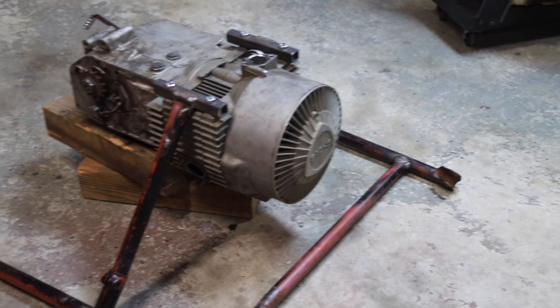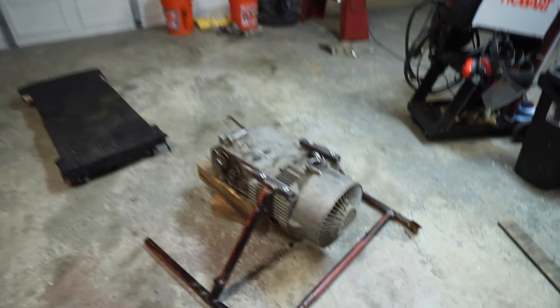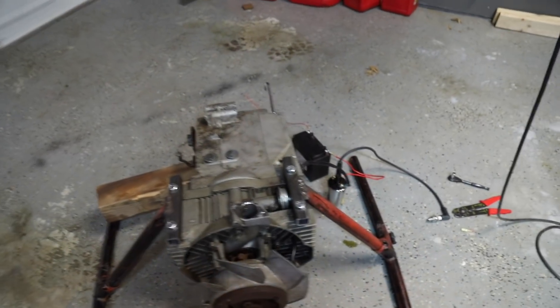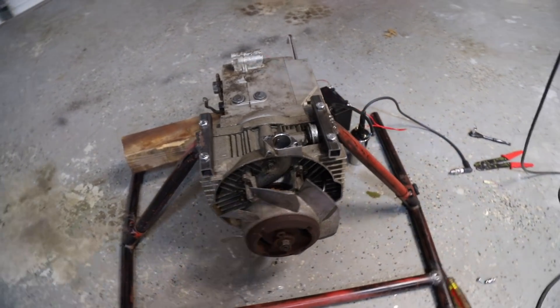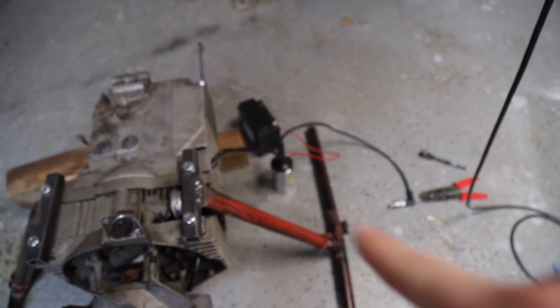This is how the rotary sits from the last episode — a complete rebuild. Now this is the really fun but also stressful part. We've spent a lot of money on parts and a lot of research and time rebuilding this thing. We need to just get down to business and get this running. We are doing a battery-operated ignition system. You can do this on any engine that has points — just be careful that when it's switched on, the point is open so you're not grounding out the circuit.